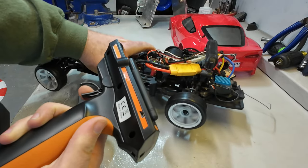Make sure ABS is off. For steering endpoints on a drift car, I leave them all at 100. I know that risks burning out the servo if you hold it hard to one side for too long, but I just don't do that. I set the endpoints with the gyro itself — depending on your gyro, you'll need to set endpoints based on its own instruction manual. I've done a lot of different gyro installs, so if you have a question on a specific gyro, let me know and I can leave you a link in the comments.